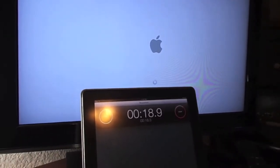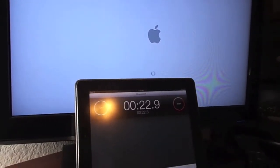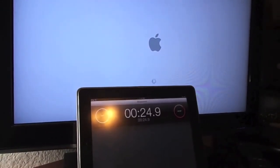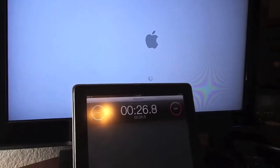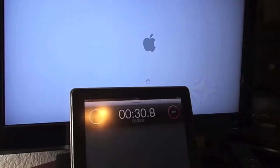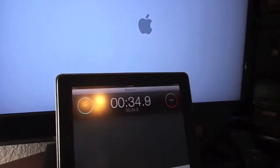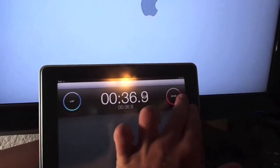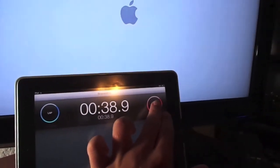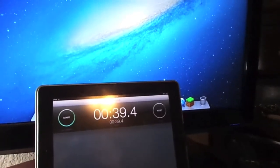I would suggest getting an SSD in it — even putting one in the little tray in the bottom, even though you have to take out everything. There's a little tray in the bottom; you can put an SSD in there and set it as the main drive, and that will really increase the performance. We'll put 16GB in it, and that will also increase the performance. So, as I said, about 39 seconds.